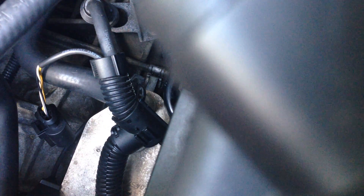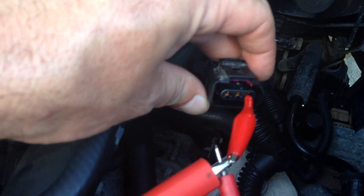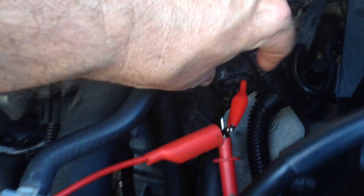I need to set this aside for a second so I can reconnect the meter. You'll have to forgive me — trying to do this one-handed with a camera, test leads, and clips doesn't always work out when you don't have someone to help you. Alligator clips and T-pins don't always work out like you hope. So, just a front probe in — I've got the two alligator clips together and my meter in the middle of it, so I can find continuity to check the wire. I already know where I am in the circuit, so I'm not worried about it.